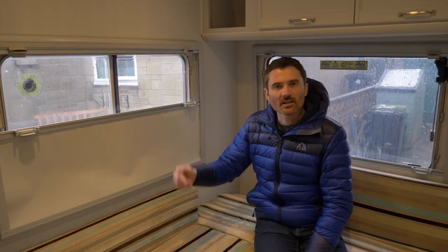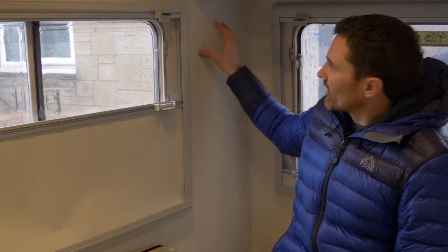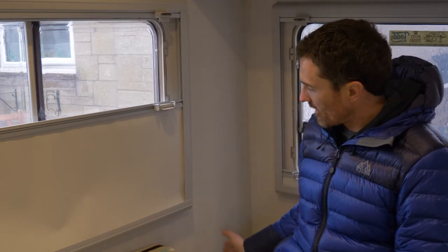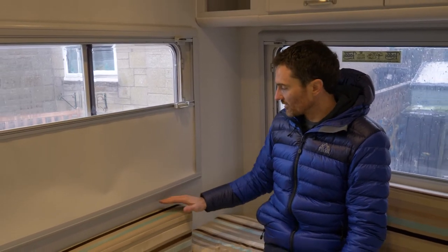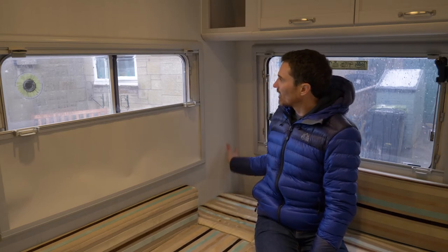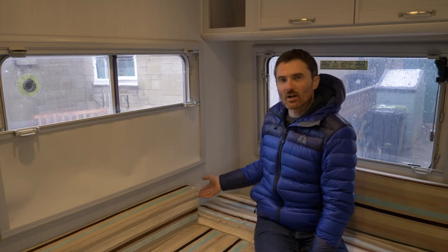I've got both types and I'll put a link below to show you which ones I've bought. You just move the tester around the wall and get your damp readings, which gives you a really good map of where it's wet. Even if you can't see or feel it, there might be elevated moisture levels under there, and that'll give you a general idea of where the water is coming in.